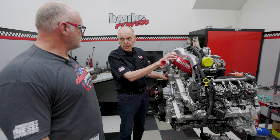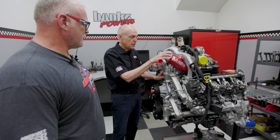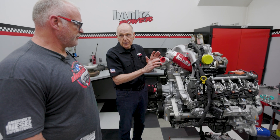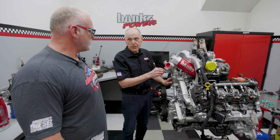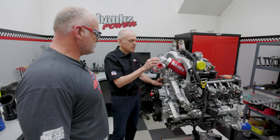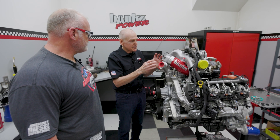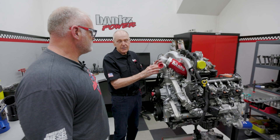This results in less pressure drop from here to the compressor — basically unloading the compressor, requiring less drive pressure to run the system. The volume and the way we flow onto the wheel is more uniform than the stock setup, so it loads the wheel symmetrically, gives you better compressor efficiency, which also drops the drive pressure requirement and makes less heat to the air when it compresses it. The volume also gives you what I call gulp capacity — when you nail it, the flow into the compressor is instantaneous, present right at the face of the compressor wheel.